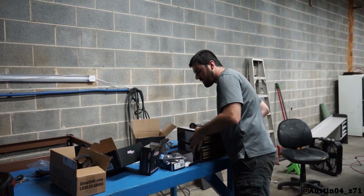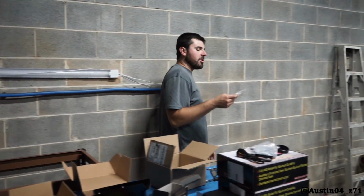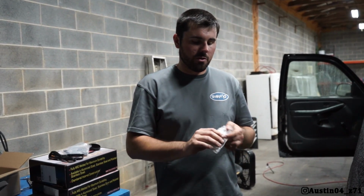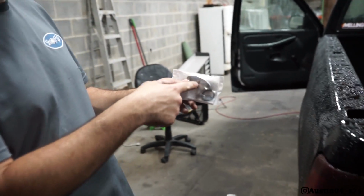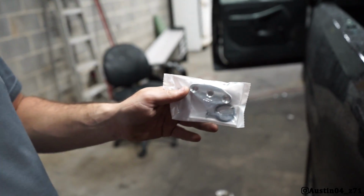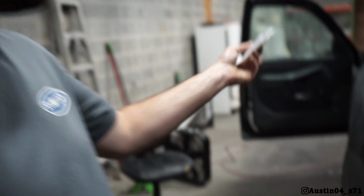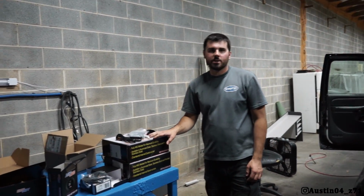And what we're going to do for that, I had a piece. I know I had a piece. How we're going to do that is where they have it capped on the oil pan for the oil cooler. You can add an oil cooler onto a 5.3. There's our adapter plate. And what we're going to do is they literally send an 1/8 inch sensor, and that's what that hole is. So when I put this in here, I can screw that right in there, run the line up to the pillar, easy peasy. So this is not going to be a hard deal.